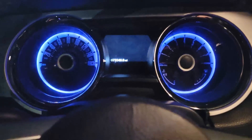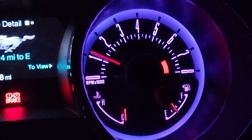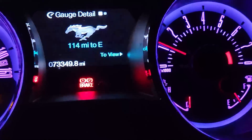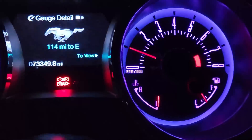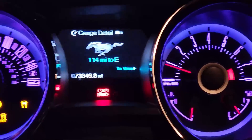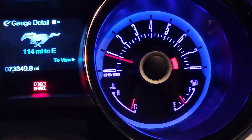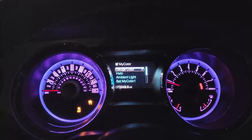I like data logging at night because there's a lot less traffic to deal with. The car has purple ambient lighting and I need to change that in the color display. The goal for today: get some data logs on it. I finally got the tank down to under a half tank at 73,000 miles. I'll stick the N-gauge in on the stock tune — it still has the ABS issue — and see if the knock sensors are unhappy. If they are, I'll fill up with Shell 93 octane, drive it a bit to mix, then data log again with the same tune and no changes.